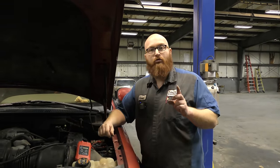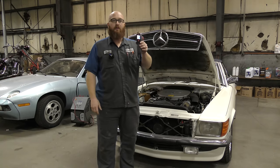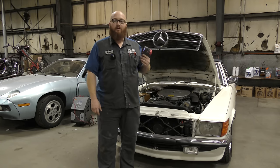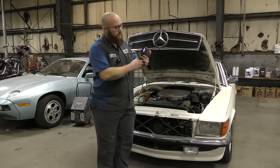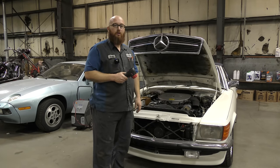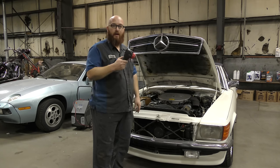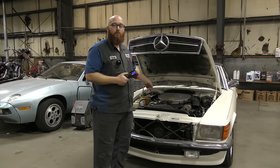So I have one more tool to show you. We're going to move to a different car. The last tool I want to show you guys is a thermal imager — a little thermal camera. This one's a cheaper model. They make some that are way more expensive, two, three, four grand. I can get the work that I need done with the much cheaper tool, so that's what I went with. You can see my hand shows up orange. You can use this tool for so much on a car. Today I'm going to show you how you can find a misfire — which cylinder it is — by just looking at the exhaust manifold. I have purposely unplugged one of the spark plug wires on this car.